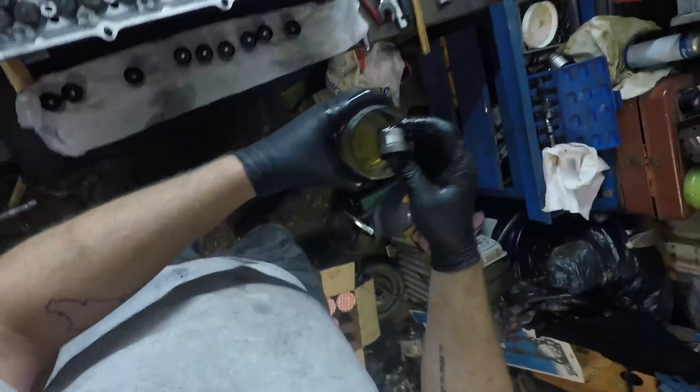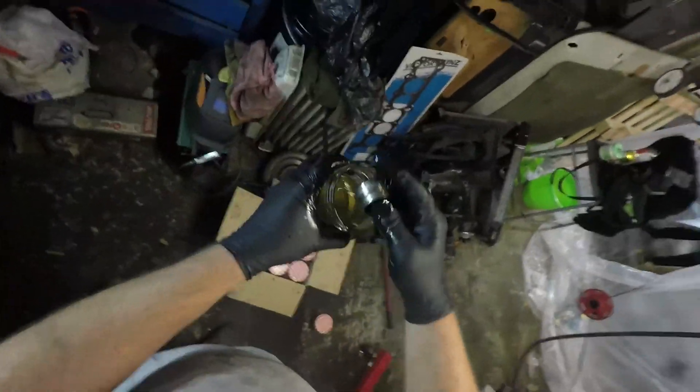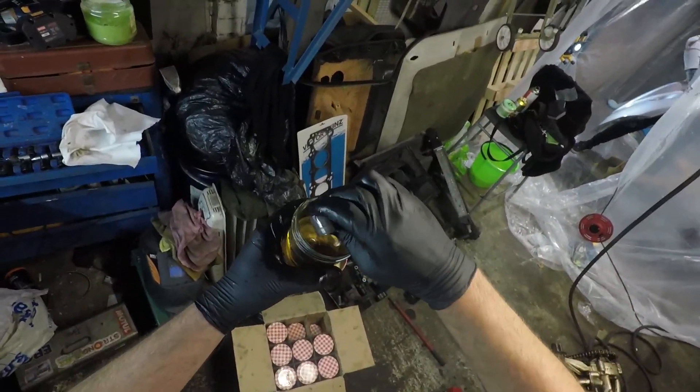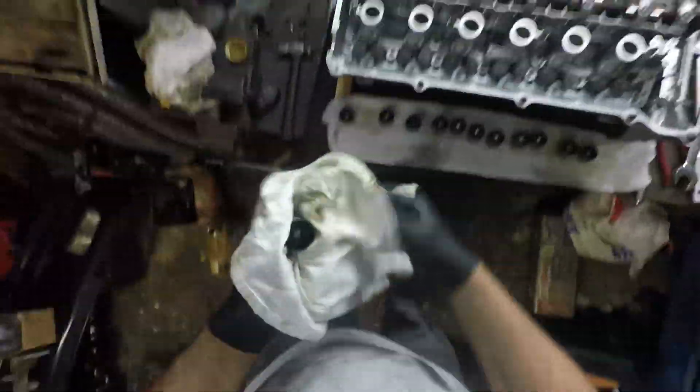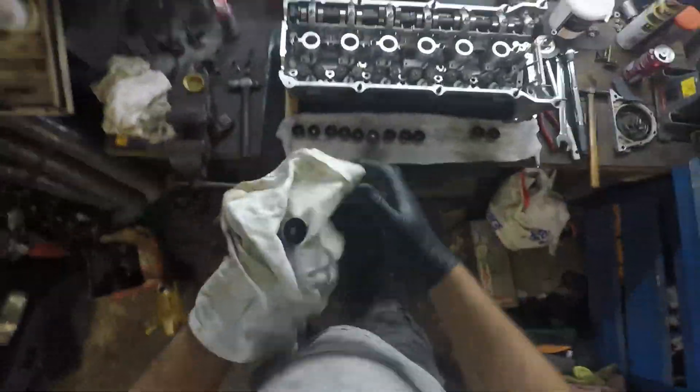I'm draining out any excess diesel from the clean lifters. Each lifter has been kept in its own specific pot with an engraving on the outside of the glass jar so I know which cam tray slot they relate to. I'm going to lay them all out in front of the cylinder head, get the whole cam tray, grease it all up and slide them in, and slot it down onto the head. No magnets needed when you've got the head on a bench, but we do have to take a lot of care to make sure it's nice and clean.